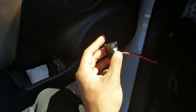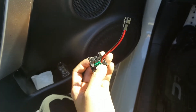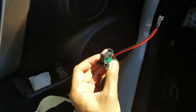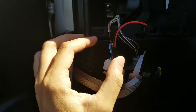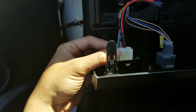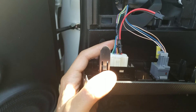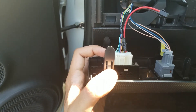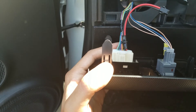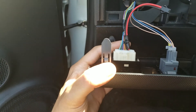The last thing I did was replace the wire on the back with a two-pin wire so that I can just plug it in. Here's the other two-pin wire — this is the wiring harness for the mirror. The last two wires are white with a black stripe, which is the negative wire, and then a gray wire which is the positive that's only live when the car is on.